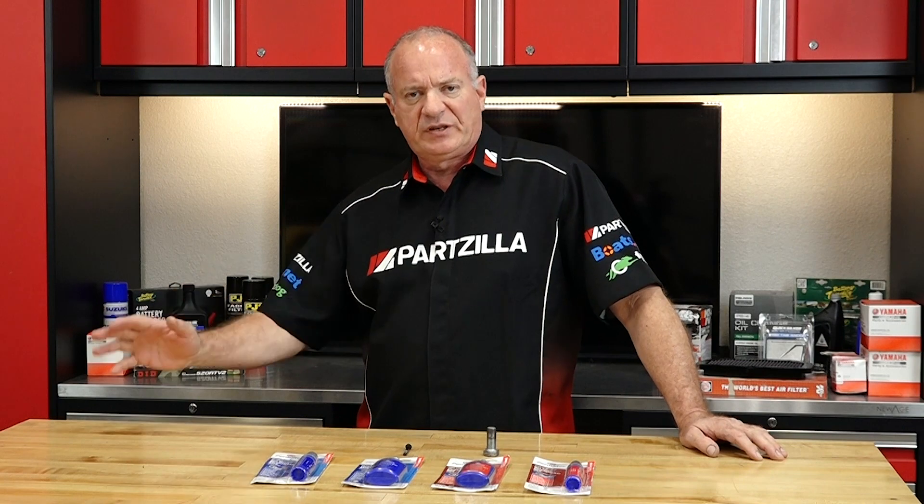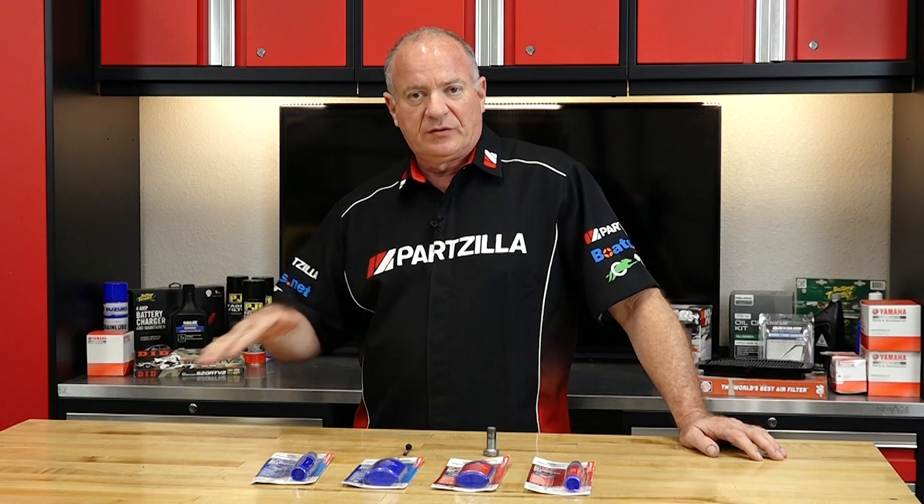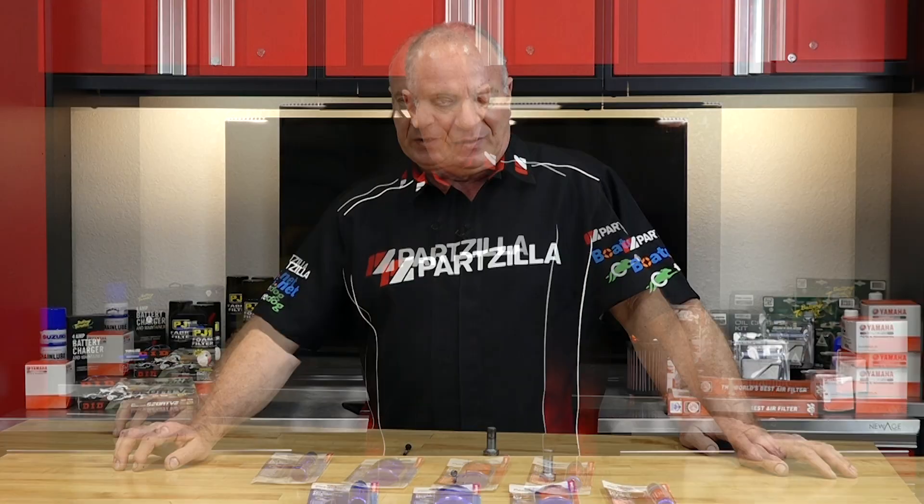Now here's the other side effect of that. If it's forced out all the air, that's going to keep corrosion from actually working its way into the threads and freezing up that particular fastener. Now if you're in the marine industry, that is invaluable because that is the harshest environment — saltwater doesn't get much worse than that. Also, it makes it easier to assemble because it acts as a lubrication as you're putting it together.